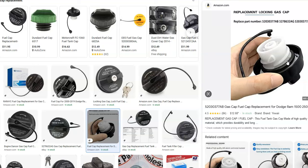If the gas cap looks bad, go ahead and replace it — but be sure to get an OEM original gas cap, as third-party gas caps don't always work well and can cause issues. Make sure to replace it with the correct original OEM gas cap.